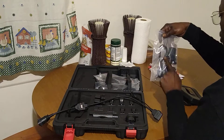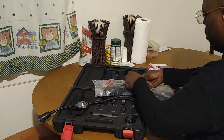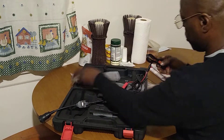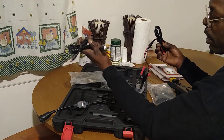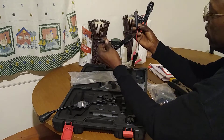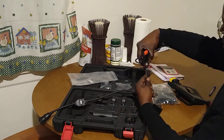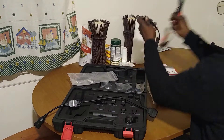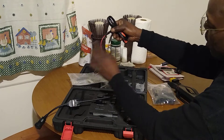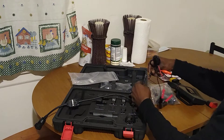Tighten down. These are powered differently — the OBD2 port has normal power. This charges the element, and this powers your OBD1 and other hookups. You've got the battery adapter for the car lighter — plug that into the lighter, it has a fuse inside and comes with extra fuses. Or you have the battery clamps, with fuses on each side and extra fuses, to clamp to the battery leads and connect it here.